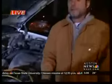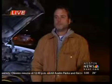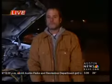Yes. Okay, David, quickly, before we let you go, tell us about the sequence of starting the cars. If you got a dead battery, do you hook the jumpers up and then start the car to jump it off of, or do you already have it started and then put the jumper cables on? What's the best method? It's best to have the engine off and then hook all your cables up, and then start the other vehicle that you're jumping your vehicle with and let it run for about a minute or so. It charges up the battery so your car will start. Then get in and start it.